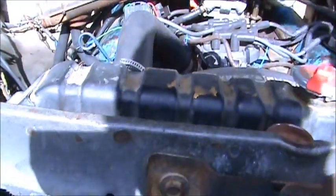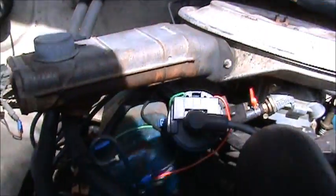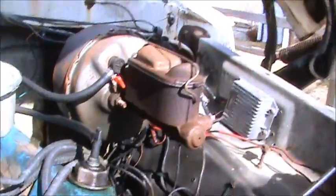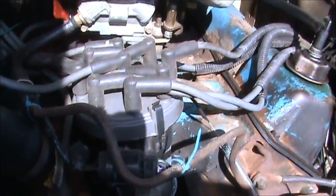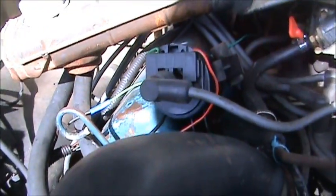Open the hood, get the hood up, I'll show you. Had issues with some stuff that's probably pretty evident — this coil's bad. Anyway, it's leaking, but that's a side point. The deal with what's happening is it would stumble and cough and it didn't run right. I figured out I wasn't getting 12 volts to the coil — remedied that problem.